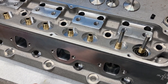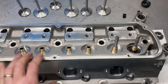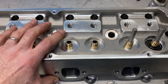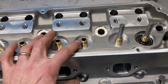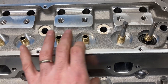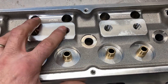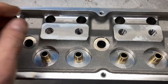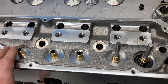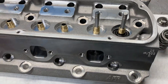That's me walking through and thinking out loud on valve spring packages. I didn't think about how small the pockets were until I got the heads out to look at them. The 205cc heads and larger don't have this issue. But if you're wanting to run a solid roller cam on these, you don't really have that many options. Thankfully the rocker stud holes are 7/16ths, and I'm hoping the push rod holes are opened up as well.